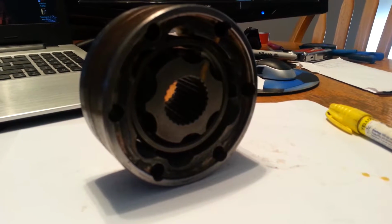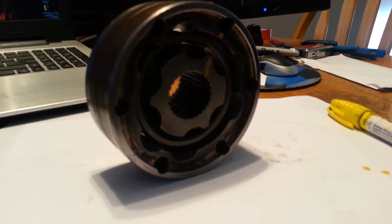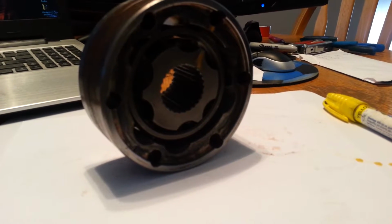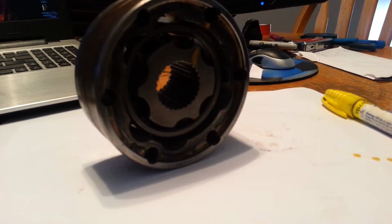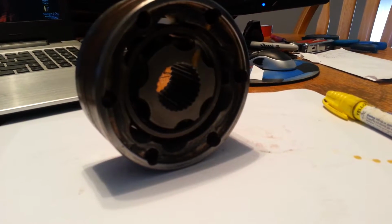There we have 3 balls in and the gear put in. Yeah, it does fit in there okay. So there's a particular thing when you're putting these balls in that kind of have a really good bearing, is that you can pull the sleeve almost all the way out. Watch where the balls are, of course, and that gear in the center.